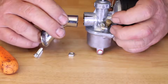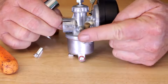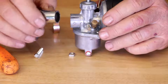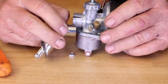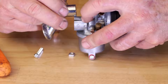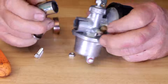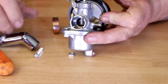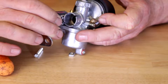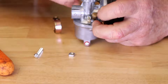If you do not have your carburetor pushed far enough in — let's say it's only pushed in this far — you have these openings where air is going to come in. If you look inside your carburetor, there's a stop here that limits how far this can go.